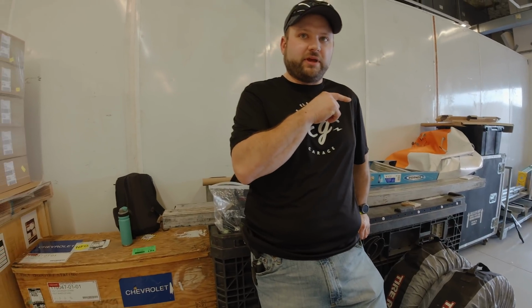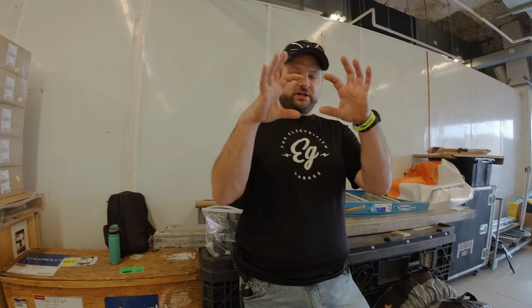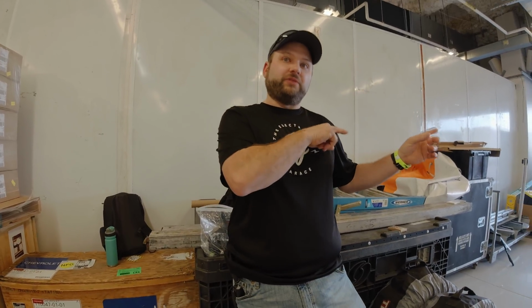Oh, I see. I always wondered why they did that. I was like, why add an extra, different coolant, a whole new subsystem? It's got to be something. On the Model S, the front powertrain, they did that same thing. They oil cooled it with a heat exchanger. If you look at the front powertrain, you're going to see a heat exchanger on top of it. So that one's oil cooled too. So they were experimenting with the AC motor, and then they ended up doing it on the DC. Oh, I see.